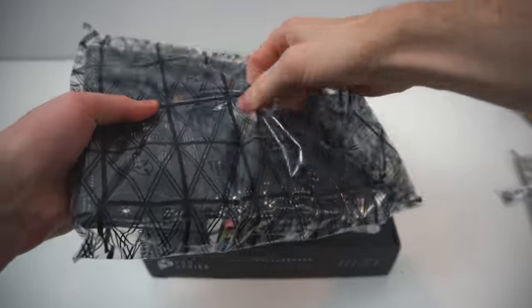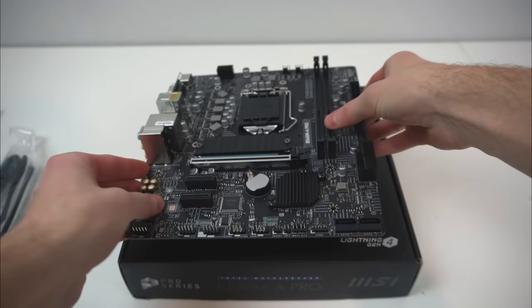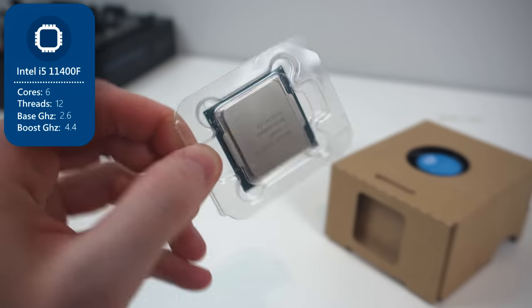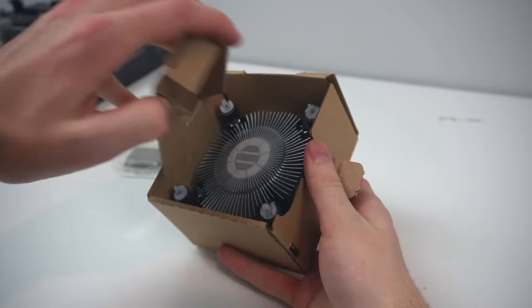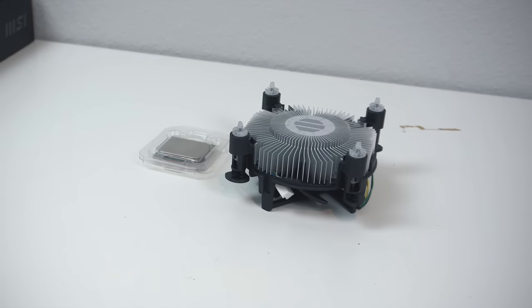So the first step, of course, would be to remove the motherboard from its anti-static bag and place it directly on top of the motherboard box. And we're doing this because the first part we're gonna install is the processor. So unbox your Intel i5-11400F along with its stock cooler. Now, if you're not too much of a fan of the Intel stock coolers, I do recommend the Arctic Alpine 12, which I will also have linked in the description. But in this tutorial, I'm gonna show you how to install the stock cooler.